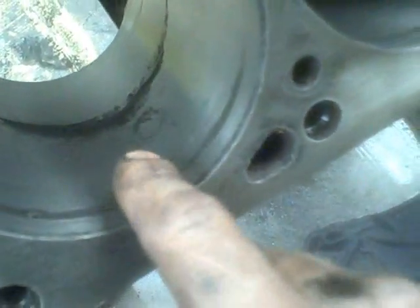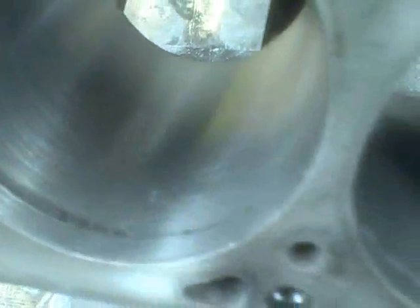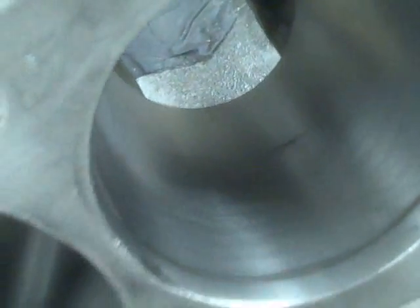Okay peoples, it's all prepped. I went in with my glaze breaker. We only got one cylinder where there's still some pitting showing, and that was the worst of them. It's actually fairly smooth on the surface; I just didn't dare take any more out of the cylinders — my ring gap was starting to get on the verge of me being uncomfortable with any wear that might happen down the road. But as you can see, compared to the finish previously that I showed in my last video, the finish now is much better. Got a nice crosshatch, it's not shiny. I used a 280 grit stone — for chrome moly rings you'd want a real fine surface, but for just a standard steel ring, this is just fine. That crosshatch will help to break in the rings and wear them into the cylinder walls, but that explanation is all for another video.